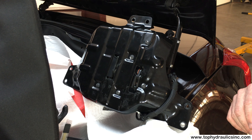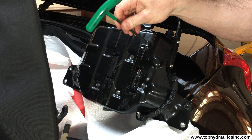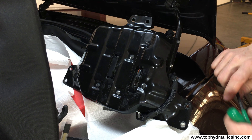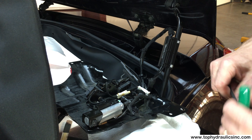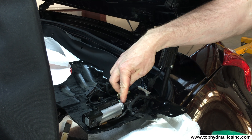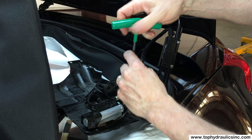Just for completeness: if you have manually opened the top and the rear striker plate is still stuck in the fifth bow latch, then you have to take these five T30 bolts off the cover plate for the rear bow latch — mounted back under the storage cover. Take these five bolts off, the cover comes off, and the latch assembly is then hanging here. All you have to do is turn the cylinder and extend the cylinder — that will open the latch and release the rear bow striker. Again, this is not what you normally have to do, but here it is for completeness.